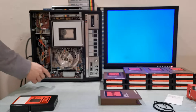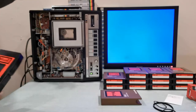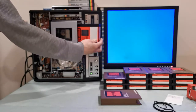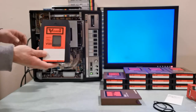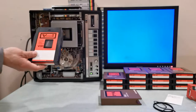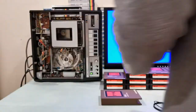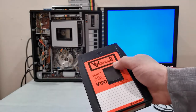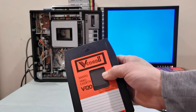The machine is very loud — I want you to hear the actuators. They always turn on when you power on this machine. Let me go ahead and eject it — yeah, very loud. Now I'll put this tape in. This is the two-hour tape. They did make one-hour length tapes as well, and I was able to find a total of 12 of these via eBay. Before I put this in, I should let you know: if you own these older tapes, there's a chance the leader — that clear transparent ribbon — will separate from the magnetic ribbon during initial playback.